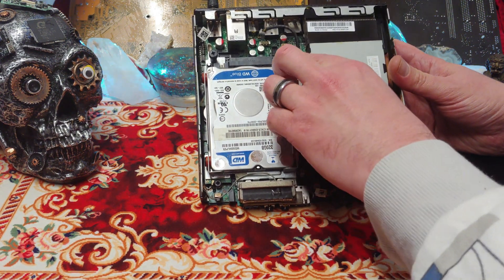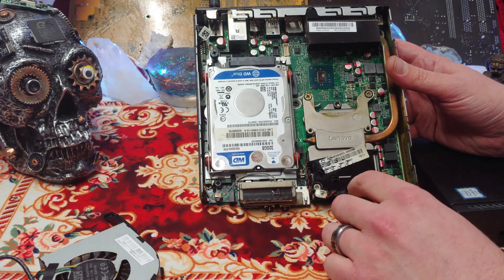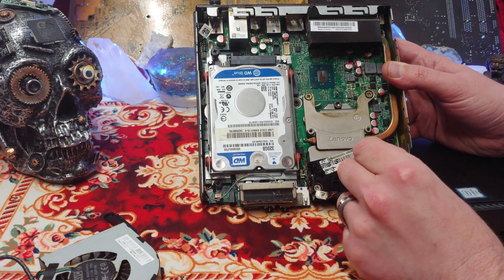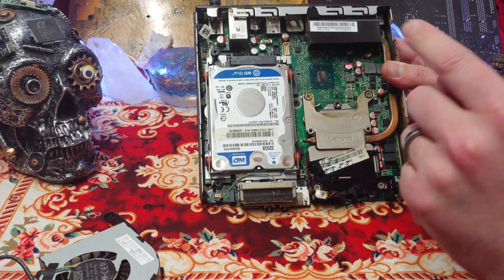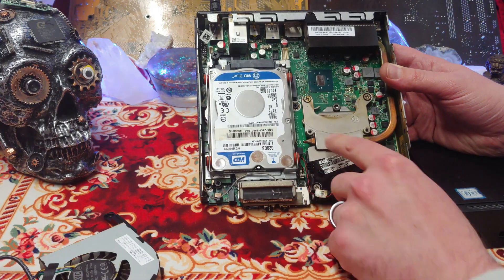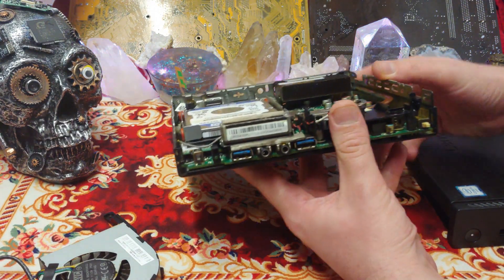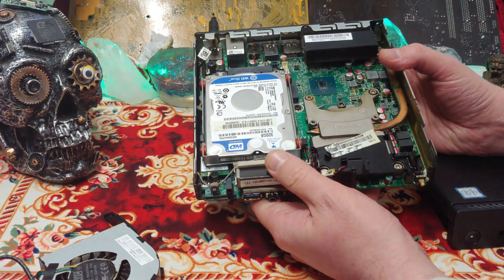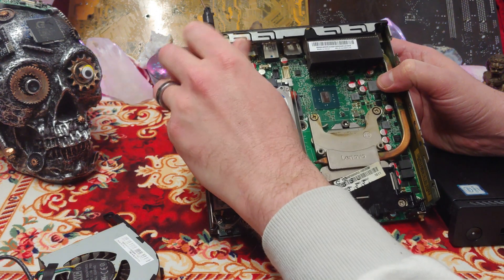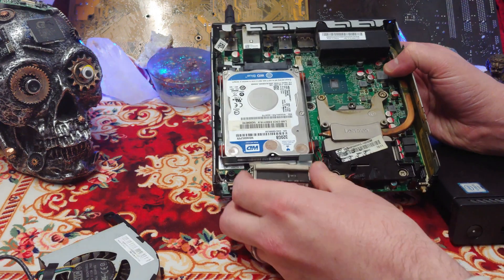If we put this over here, this thing just barely touches the CPU at all. That seems to be the thing with tiny systems. You see the north bridge here. That's just more oil. We have an i5 under here, and a lot of unused ports. Big heat pipe coming up over there. You've got to make sure that this airway stays open or air is just not going to flow through there. So let me get this hard drive out of here and see if there is a place for an M.2 card under it.